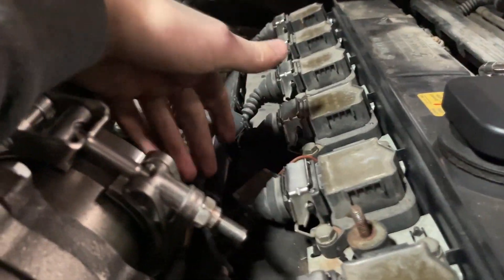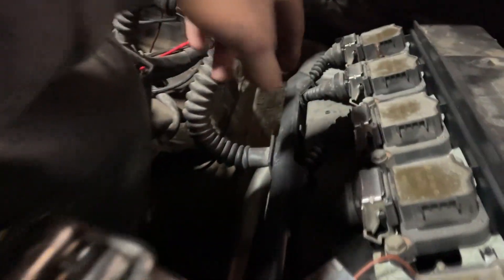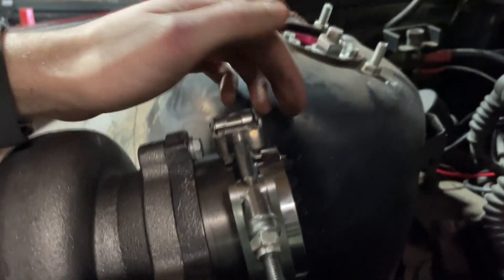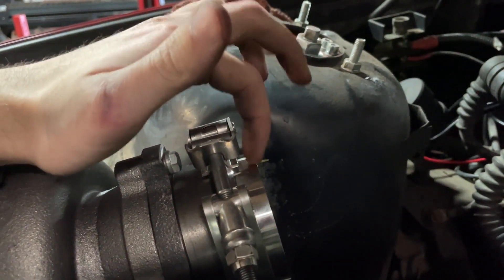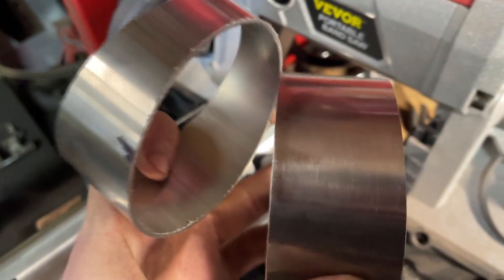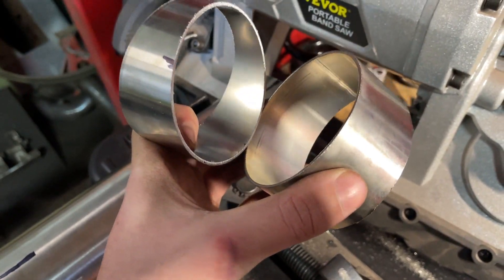The coil pack and harness side is going to have a bent aluminum heat shield and sleeving over it. It's going to go straight, make one turn around here, and start going down through that hole there. I measure the degree here and it looks to be about 10 or 11 degrees, so I'm going to do a 10-degree pie cut right here on this section and then go back to a straight section. I've got a 30-degree pie cut and just a 15 on one end to clean up on the belt sander.